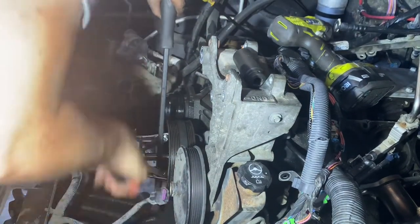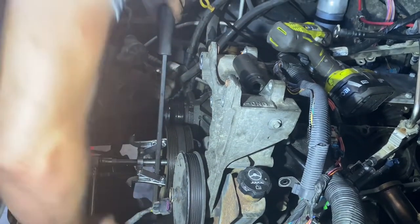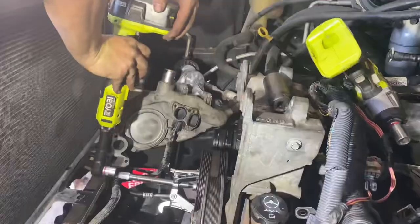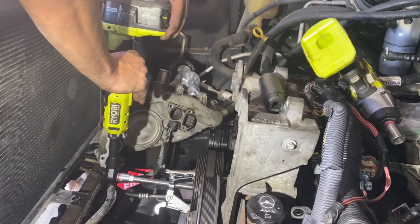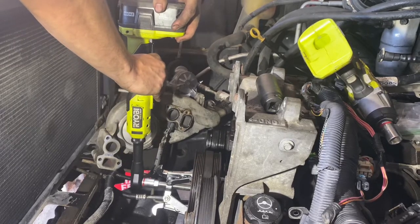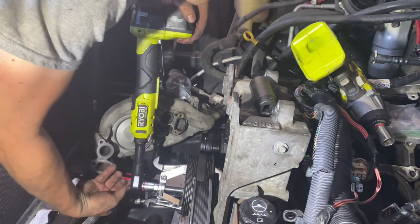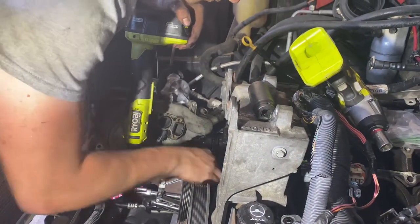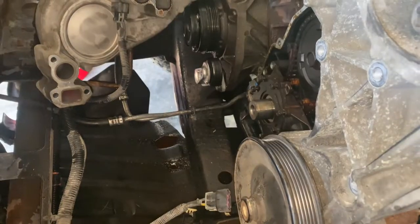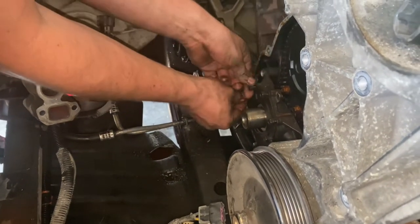We ended up not dropping the oil pan because we did it when we put on my headers, but of course we were not expecting to do it now, because we did not expect that in order for the oil pump to come down, you have to kind of take down your pan, and we didn't want to deal with that. So we did take out two bolts and we left the timing chain and we replaced the timing sprocket at the top, but we did not take out my oil pump. We did not drop the pan. We were so done at this point.